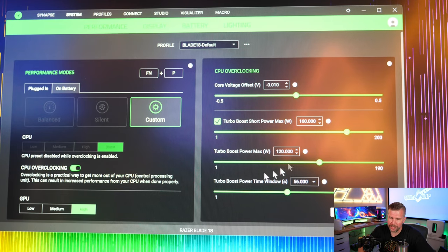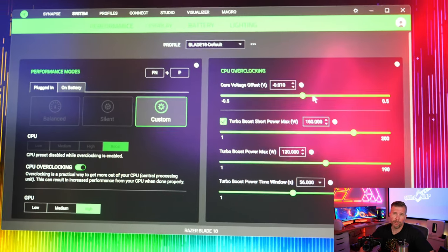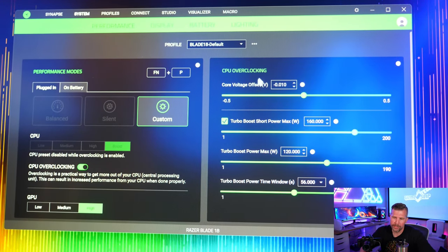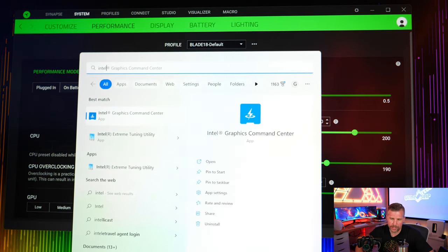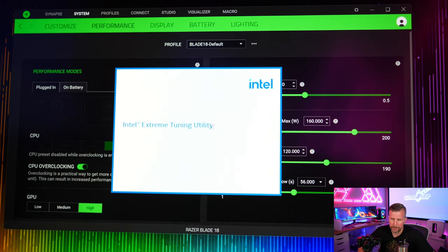But ultimately, these aren't enough controls, I think, to properly undervolt your system. You need to be able to undervolt the cache and your E-cores as well. So this is not going to suffice. If you want to do proper undervolting, you're going to need Intel XTU. So you're going to need to download that. I already installed it. But if you want to download that directly from Intel's website,